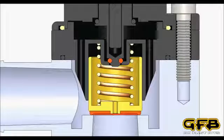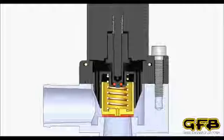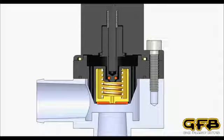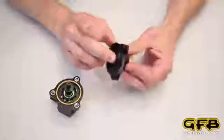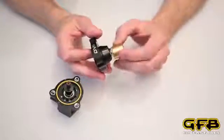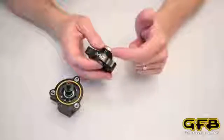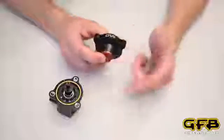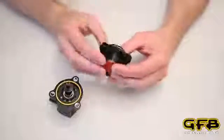When you lift off the throttle the ECU will energise the solenoid coil and the plunger inside here will retract. What that will do is open up a port on the back of the valve here which relieves the pressure from behind the piston. So now with no more pressure holding the piston closed, it's free to blow open with the boost pressure from the intercooler and that will start the valve venting.